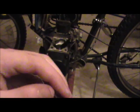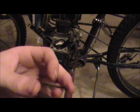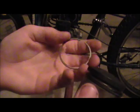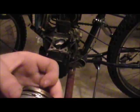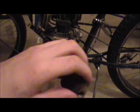I'm gonna take these rings off. What you want to do is clean out these ring grooves and I'm gonna wire brush this, so I'm actually gonna take both rings off. You should keep track of which side goes up so it fits on the pins. Make sure they're top and bottom — these might be specific, I'm not sure, but I'll just keep them that way. If I can't find rings at the salvage yard, I'm gonna get a new piston also. And that's the end of this video.